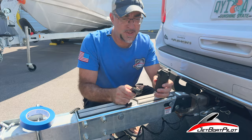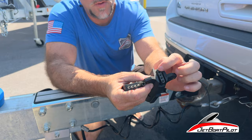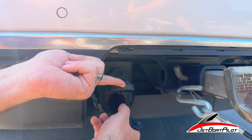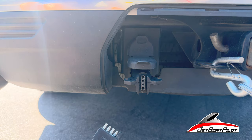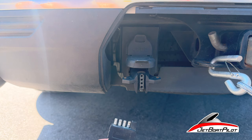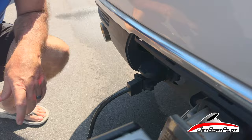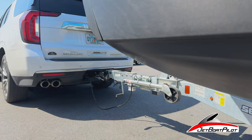The standard connection you'll need on your vehicle is one of these five-pin style connectors, or on a big SUV you'll have a seven-pin style connector. You align the tabs and they connect. Then aligning the larger black pin to the bottom exposed pin on the trailer's wiring harness, slide it in. Some people use dielectric grease here to protect against water intrusion. With a good connection, you'll be able to back the trailer up without engaging the brakes because you have the proper electrical connection.